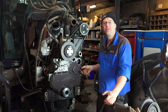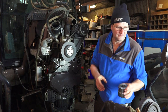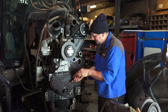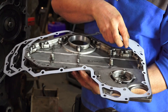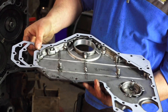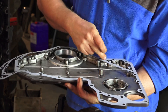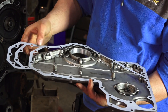Now we've looked at the principle of centralising the cover, we can take a look at the gasket — we'll take the cover back off. If we take a closer look at the gasket, I've got a genuine parts gasket here and it's got varying options on it. Not all of it is required, so there's a piece here that we're going to need to cut out. There's a knockout part but we don't need the crossbar, so we can cut that out with scissors. And again here we've got an option — there must be different types of timing covers available for different accessories.